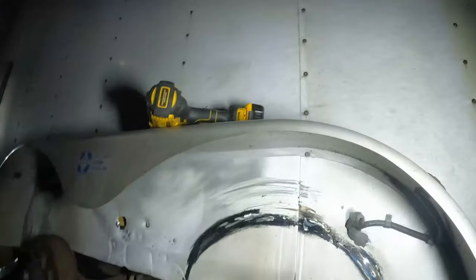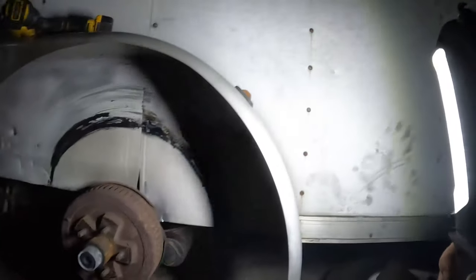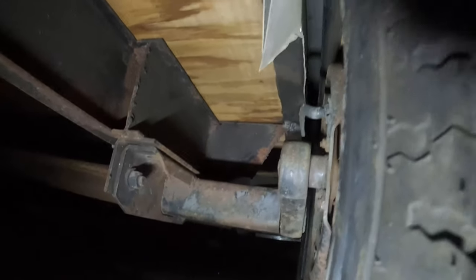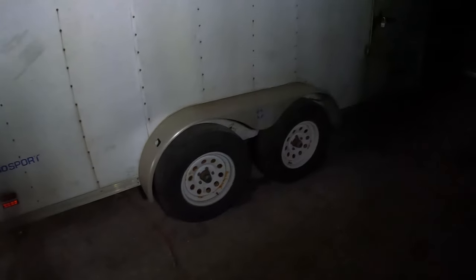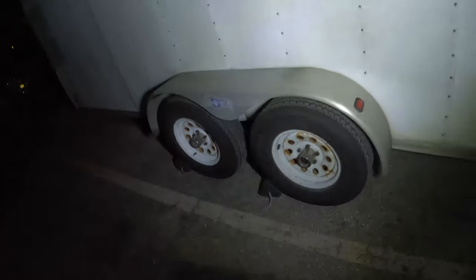I'm gonna do the best I can to get a little bit of bead on here because it doesn't look like there was anything there. I got some decent weld on that. That looks like crap but I'll tell you what - that's way better than it was. As you can see we had some major rubbing going on, so hopefully that fixes the problem. I'm gonna pull this stuff out, get the tires on, and then go check the other side to make sure those welds are in place. We got plenty of gap now and that weld is way better than what was there. She's back on her own feet with plenty of clearance - hopefully we ain't gonna be burning up any more tires.